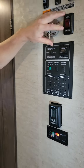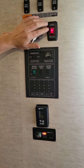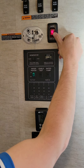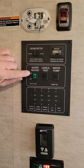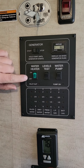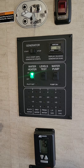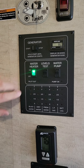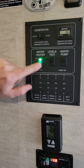Back to the hot water — 110 volt is when you're at a campsite; use that one, it turns red and it's going to use electricity to heat up your six gallon water tank. When you're sleeping in a Walmart parking lot, boondocking, dry camping, or between point A and point B, use the hot water heater on propane. It's going to light up outside. If there's an issue with it, it's going to say pilot out, which means your pilot light is not working.